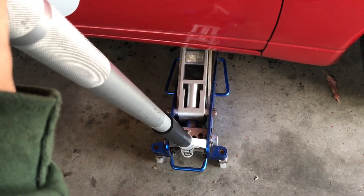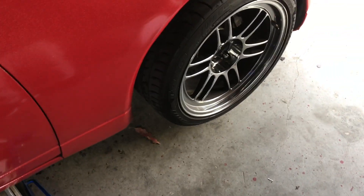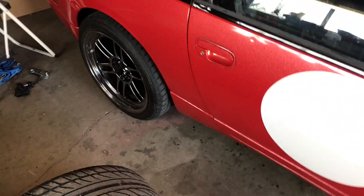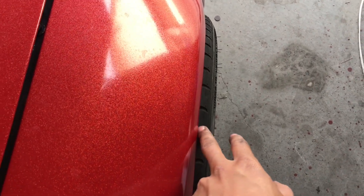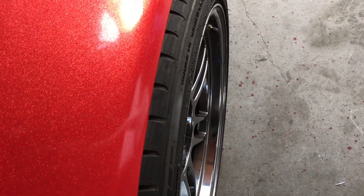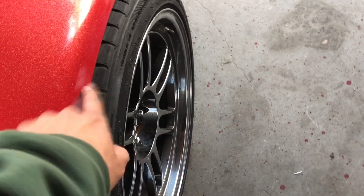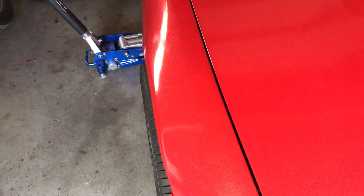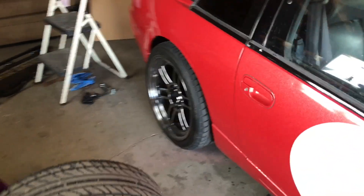I hate this jack — if you go too hard it drops super fast. Yeah, I can already tell I'm gonna have to take off that 15mm spacer. It's hitting my fender too much and I'm not down to run that much camber or pull my fender. I'll probably take that off the backs too.